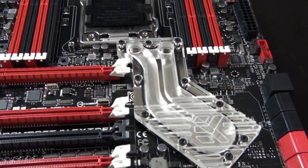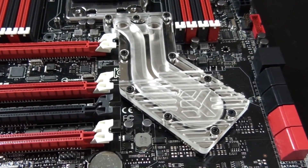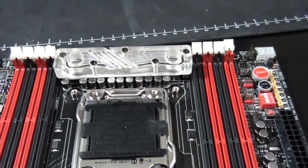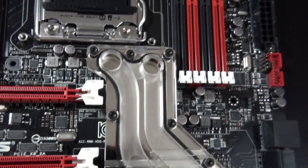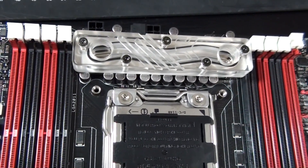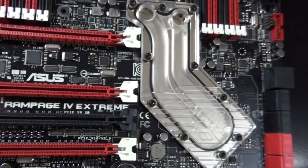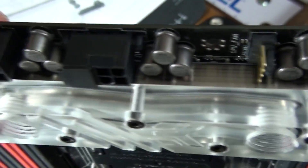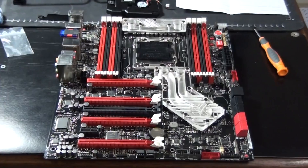The other thing is, if you reinstall the water blocks, you will also need to reapply the thermal paste, and you will no doubt need to replace the thermal pads, because after multiple installations they get really flat and can also tear. If you want to see these water blocks in action, make sure you check out the Singularity Computers Client Build 5 Build Log — the system is called Nighthawk. The temperature results are also in that build log. I actually end up installing five EK water blocks onto this motherboard, including water blocks on the CPU and memory. It's an extremely high-end water-cooled build, and these water blocks are one of the main features. That sums up this video — thanks for watching. Please subscribe and like if you want to see more.